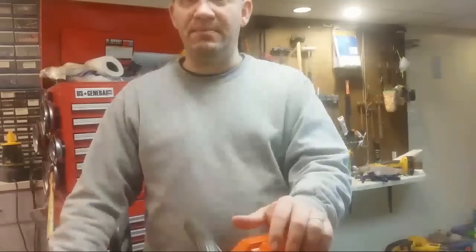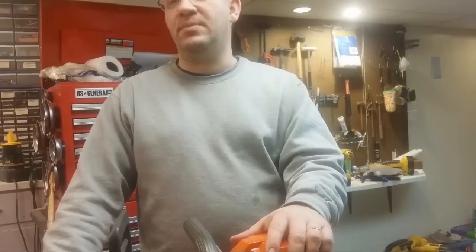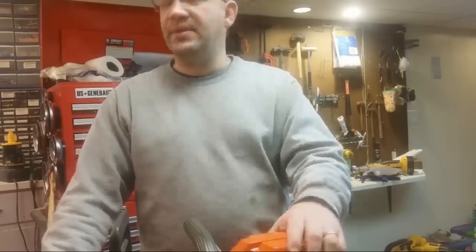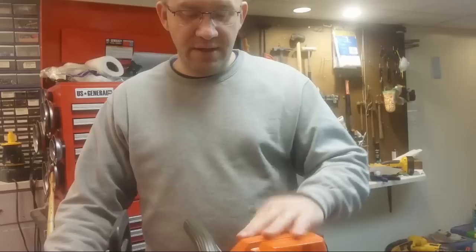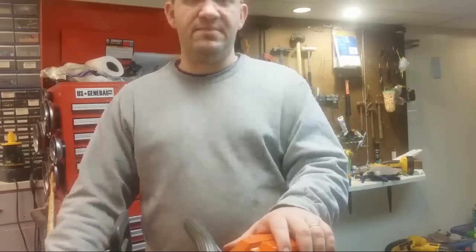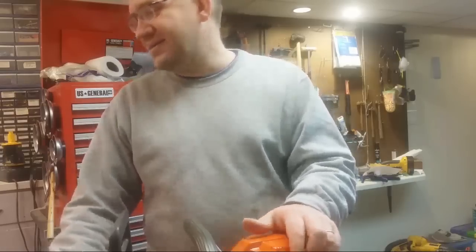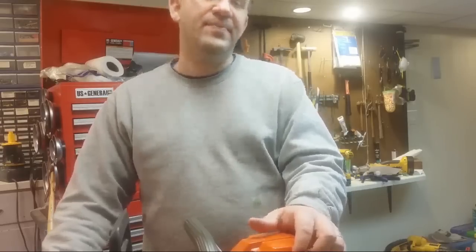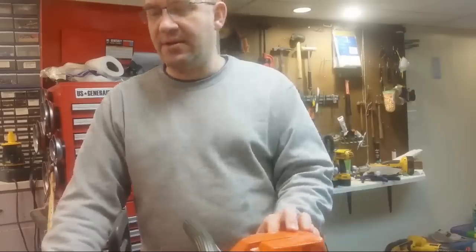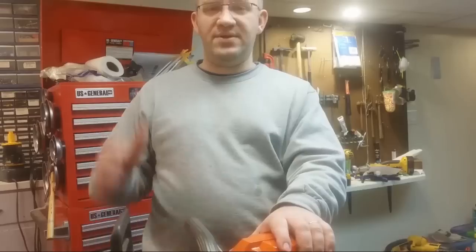And it came with a sweet bar, like the bar was worth easily more than $30. He was having trouble with it running. It wasn't running quite right, so he handed it to me and said, here, have a look. So I put a carburetor kit in it and a new fuel line in it. Four tanks later, the motor blew up. Motor seized. So I'm like, what do I do here? And he's like, just make it the best it can be. And I'm like, okay. So I put the 288 top end on it, and ended up having to put a new carburetor on the thing because I'd kitted the carburetor a second time and it still wouldn't idle quite right. It was having this dual idle thing.